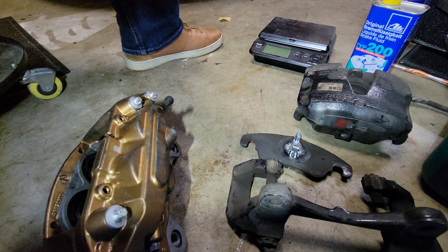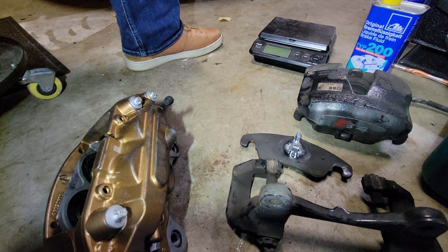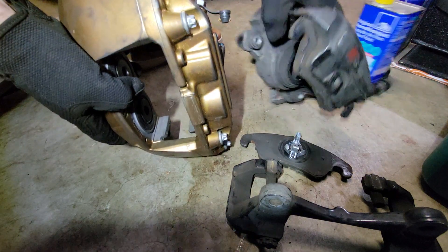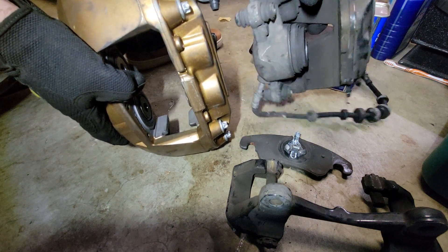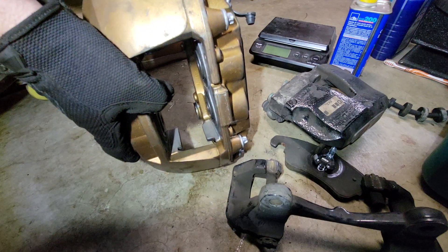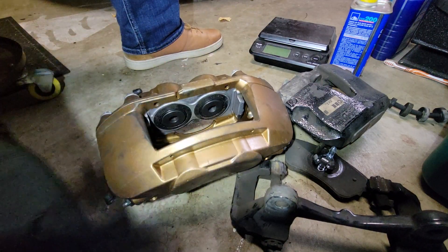Hopefully that has explained some stuff about brakes — what we mean by track brakes in our videos, why it's so important when driving around a road course, and the differences between a fixed caliper and a sliding caliper. If you have a performance car and want to go out on track, look at what you have. If you've got a sliding caliper, chuck it and get yourself some fixed calipers. If you already have fixed calipers, you're in good shape — just take care of your pads and fluid and we'll see you out on track.